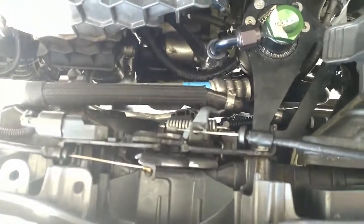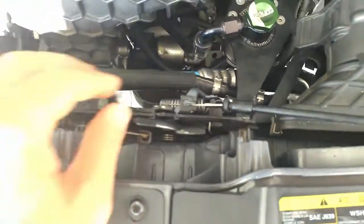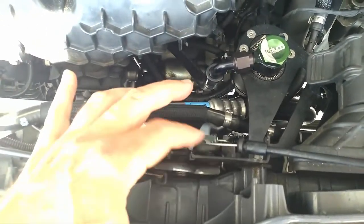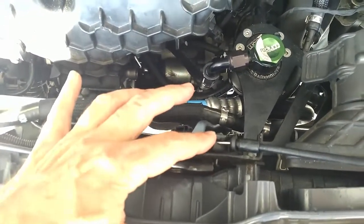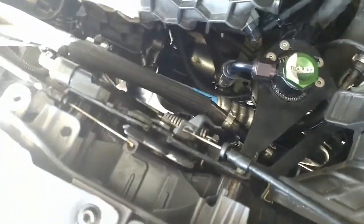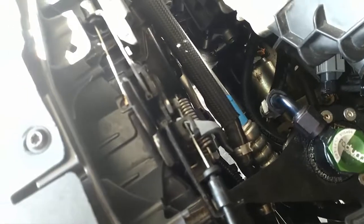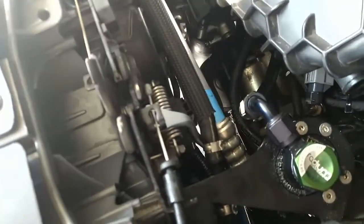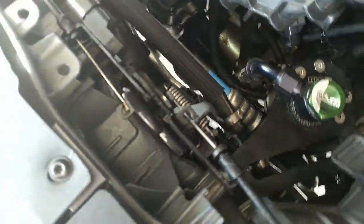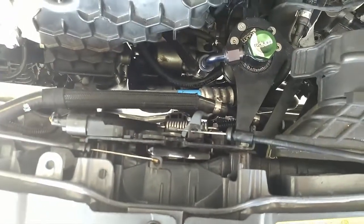Well, first of all, what you're trying to do to release it is move this piece that way, and it moves real easy. You just got to get something on it and pop it. So that's what pops the hood when it's fully closed. I ended up using a long trim removal tool, and you see it's still hanging there. I thought I'd leave it there for reference so you could visualize it when I go underneath and show you